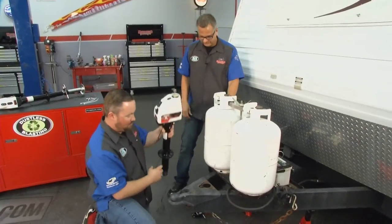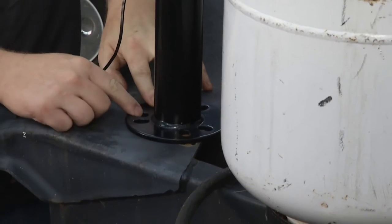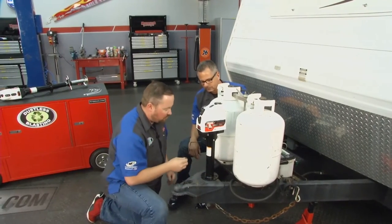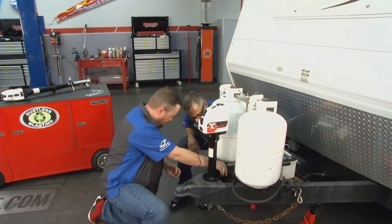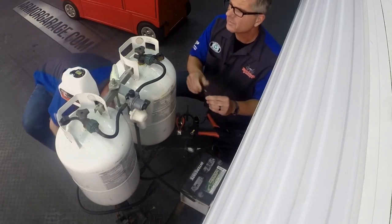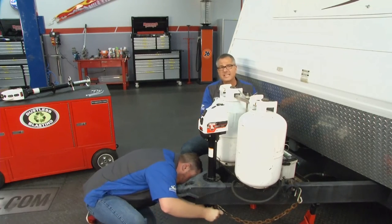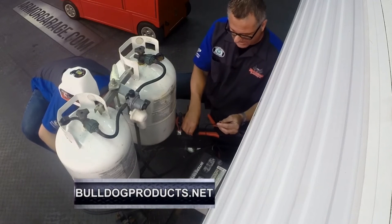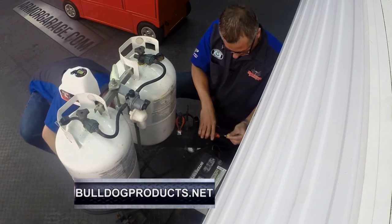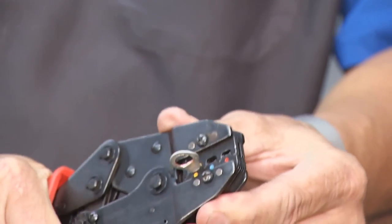You can note the ring coming into the tongue of the trailer and the multiple mounting locations. We're going to have our switches facing out — that's best for us — but you could have them facing right or left if you wanted. John, I'm going to pass you this wire — feed it through here. We're going to take the wire back; we want good wire practices and a good connection. The cool part is it's case-grounded to the frame and also has internal protection, so you don't need any kind of fuse — we can go right to the positive battery terminal. I'm going to take a terminal, pop it in, make sure I've got my white wire, then come down with my crimping tool and crimp it.